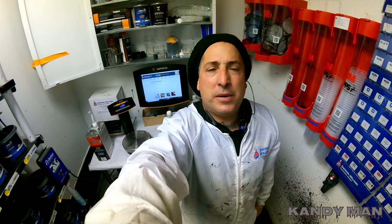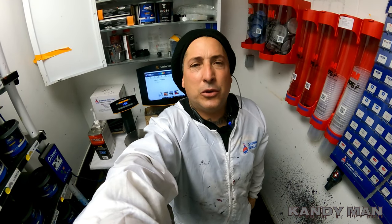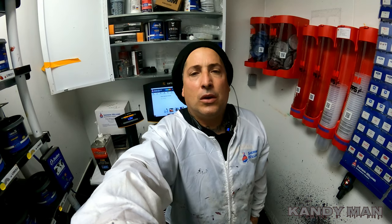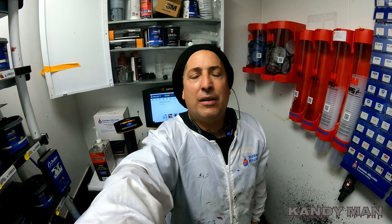All right, guys, so I'm in the mixing room and I wanted to show you the clears that I use depending on the job size, because I'm not dealing with different temperatures as much as you guys are without heat. I have heat in my booth. So when you guys are spraying a job outside in a garage, you don't have any way of controlling the temperature. So you got to base it on your clears and your different reducers and hardeners to speed you up or slow you down based on whether it's hot or cold out. So I'm used to that.